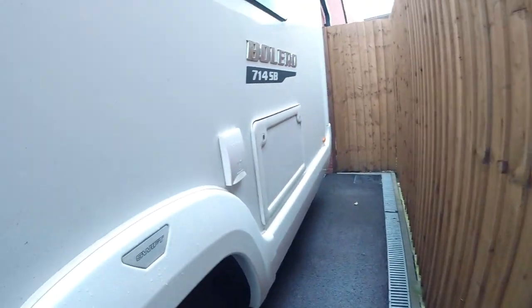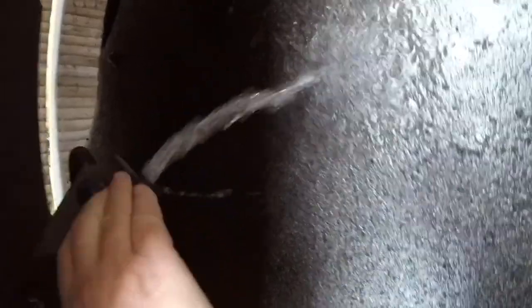I'm going to repeat that a couple more times so I won't film all of that. Basically, let the solution in overnight, let it out, run it through the taps so the pipes get cleaned, then let it out. Drain the van down like I've shown you, then rinse it thoroughly — at least two or three times — doing a complete flush and drain down. And everything should be good and safe to drink.